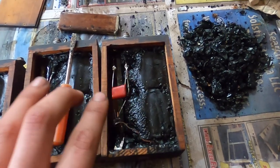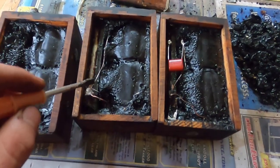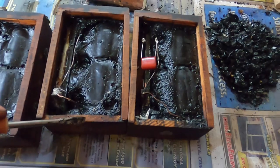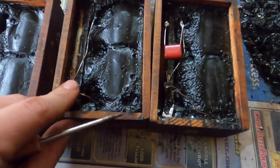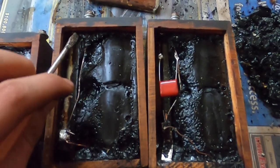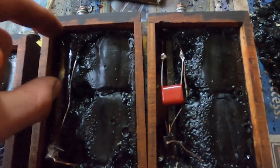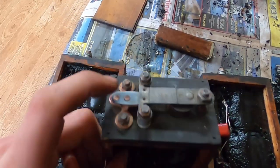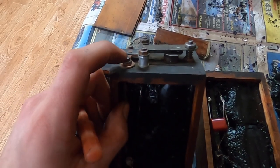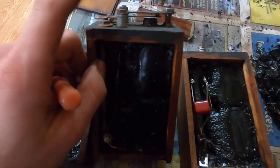You just have to solder it in between the two wires. On the original capacitor you have a long wire that goes to the top contact post, comes down and hits the bottom of the capacitor, and then goes down into the windings. You have to put the capacitor between this wire and the top wire right here. Sometimes you'll occasionally see someone put a capacitor on the outside between the two contact posts — that works, but it doesn't look good and doesn't work the greatest.